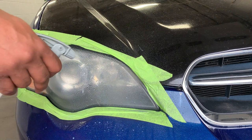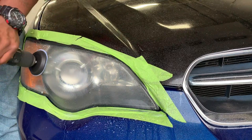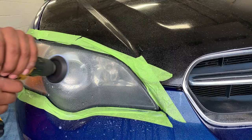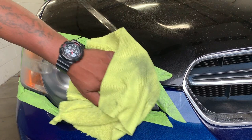We're going to spray it with the spray wax, and you want to go in a back-and-forth motion as the sandpaper is spinning, so you're covering all of the surface area and in between the cracks and layers. I also periodically spray more spray wax, because you want to keep the area wet — that's the whole point of wet sanding.